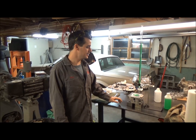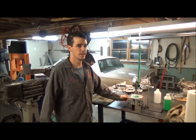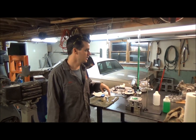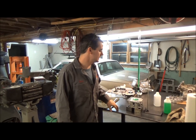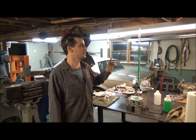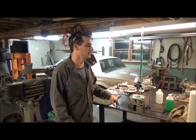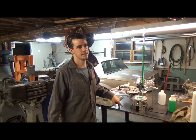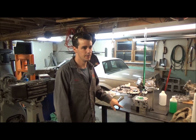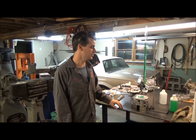We're back over on the bench. I took the head out of the Bridgeport and unjigged it because I took what I wanted off, so I figured we'd do another CC test. It came in just above 19cc's, which still seems slightly bigger than we wanted, but we ran the numbers and the compression ratio is about 10.4 to 1. We were shooting for 10.5 to 1, so that's good enough — I'm not going to bother putting it back in just to take another few thousandths off.